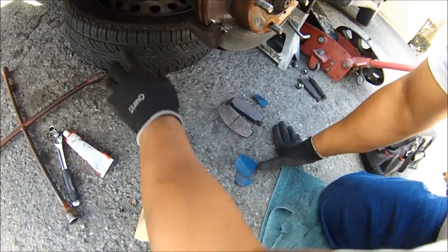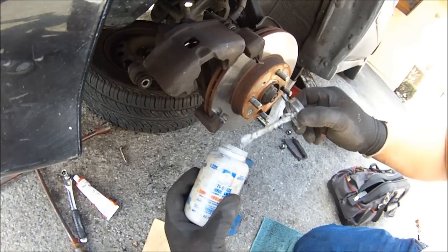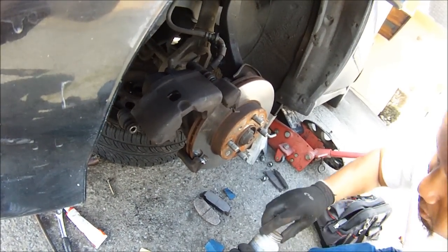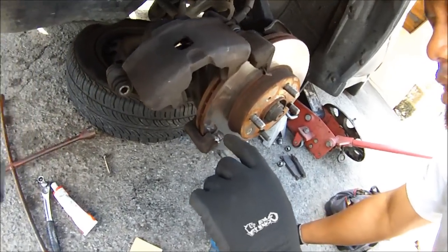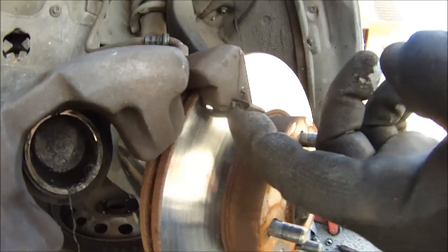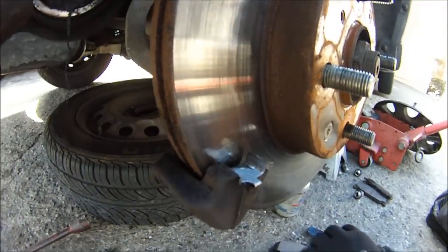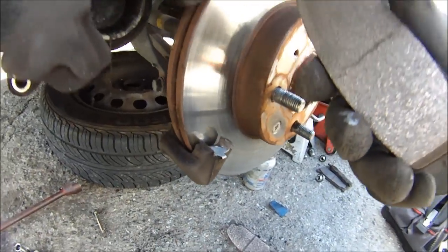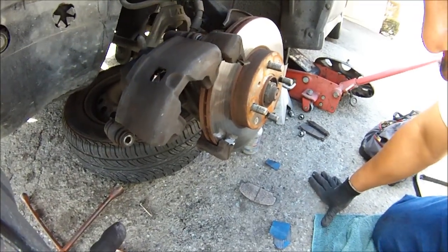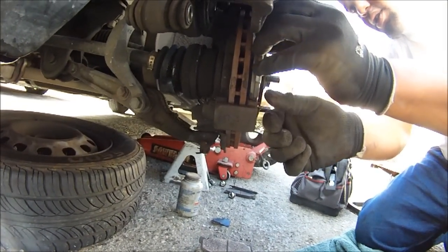These retainer clips - after you get them cleaned up, this is anti-seize right here. Put some anti-seize on like that. Make sure you don't get the stuff on the rotors. You want to get the anti-seize on the clip, on the inside like this. Now let's put this pad on - this is the one that was on it and it's got plenty of pad. So let's slip this on like this - put the pad on like that, squeeze it in. Done deal on that.